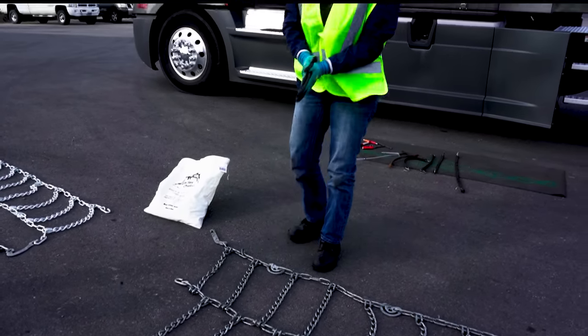Now I need to make sure the chain is even side to side. Because we don't have this chain marked for center, I'm going to lay this out looking at this rail here and over here. Now we see how this is basically dangling - it's not even got any slack. But that is kind of pooled up over there on that side, which means it's moved in that direction a little too much. So I'm going to come over here. Remember we're working with that trailer over the top. I'm going to lift the chain just a little bit, then pinch it with my leg and then work that slack in that direction. It only takes a little bit to move that chain where you're going to need it. We're going to continue making sure that our cams have remained open and that we're not twisting anything.